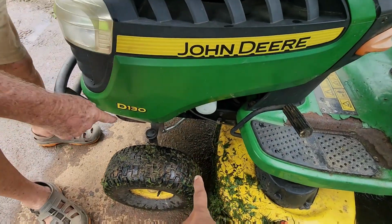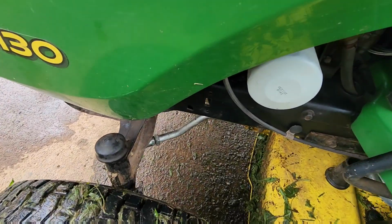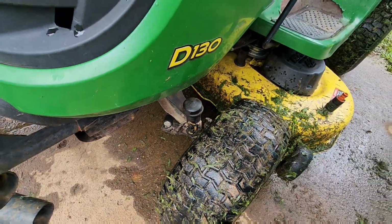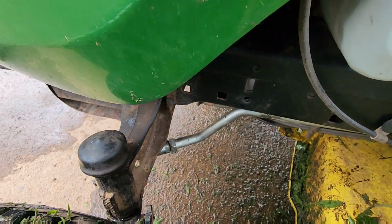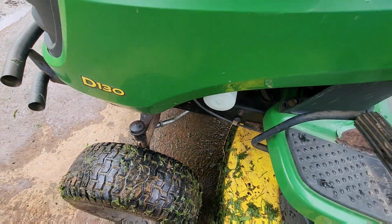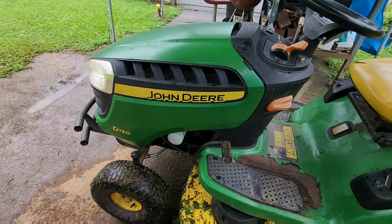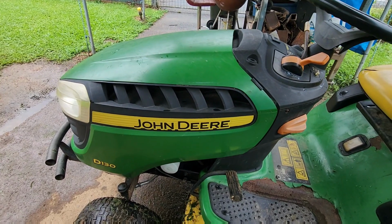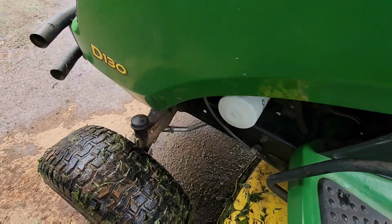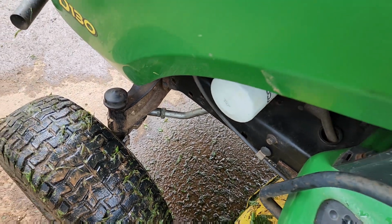Well, I adjusted the tie rod in here because it was already at maximum adjustment, like maximum shortness. There was no more adjustment, so what I did, I cut off about 8 or 10 mil of the tie rod end, and I also cut off the equivalent, about 10 mil, of the shaft because it was bottoming out before. So it looks like it could still go maybe another couple of mils, but that is miles better than it was. We'll leave it for now.